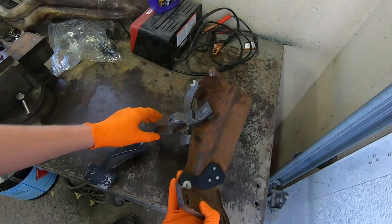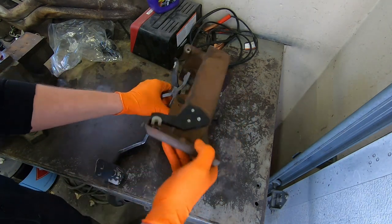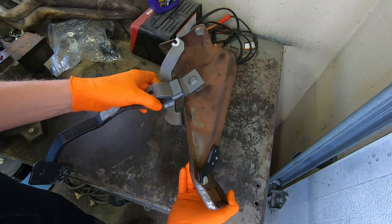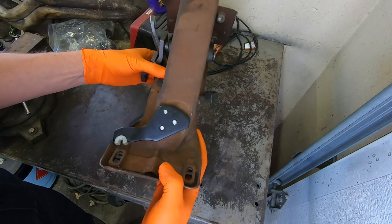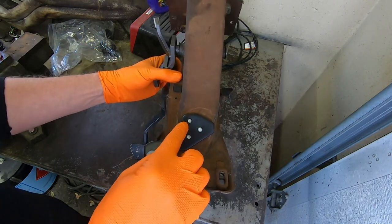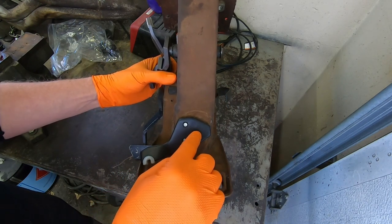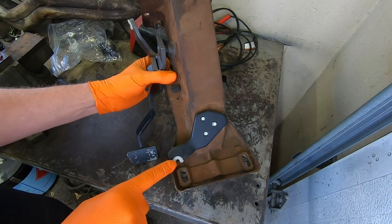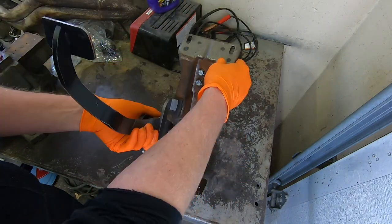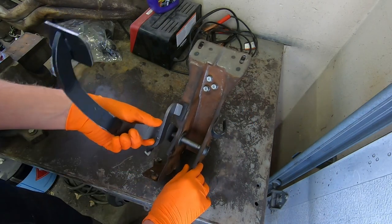We're putting these pedal supports together — they're slightly tricky. We're going to do this outside of the car so you can get a really good visual on what's going on. First and foremost, you have to add the clutch return spring bracket with three bolts. An insulator bushing goes here and on the clutch pedal as well. The other thing you're going to add is just a little rubber bump stop right there for your clutch pedal.